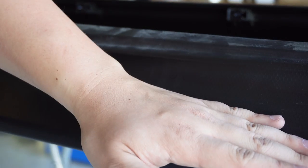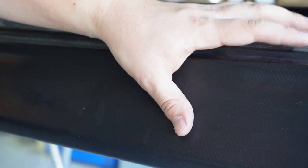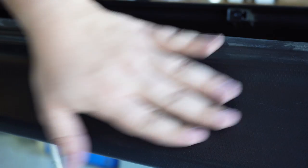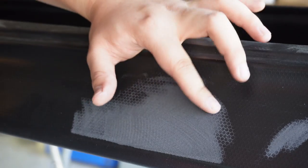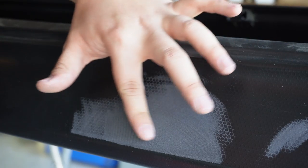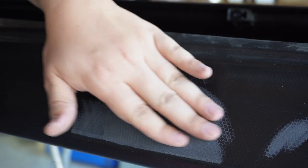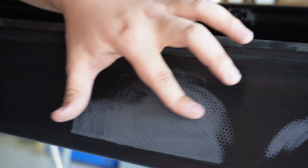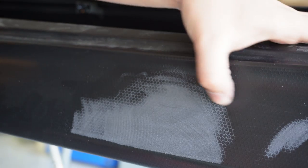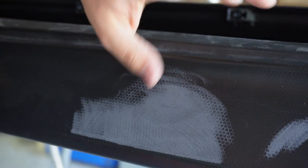As for the sanding portion, you can kind of see this texture here. I'm going to do a pass with the sander and show you how far you've got to go before you spray down the sandable primer, then sand that and try to get as smooth a finish as possible. You're looking for a really smooth finish — if you go too far it almost gets a little fuzzy and you're going to have to sand that out with the primer. You're looking for a finish where you can't see or feel the texture anymore, and it's relatively easy. You don't need to sand a ton.